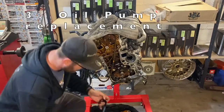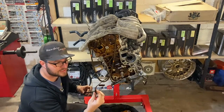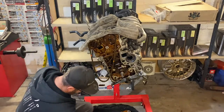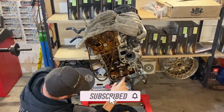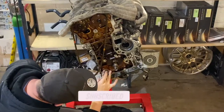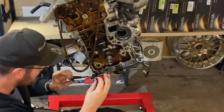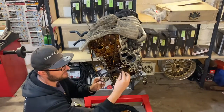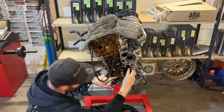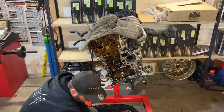After further research I realized it's true, so thank you for that recommendation. It goes without saying that all gaskets must be replaced — this is the old one, this is the new one. It's always important to make sure that the surfaces are really clean where the gaskets sit. There's only one way this gasket can be reinstalled, which is just the thing I was checking to make sure I do nothing wrong. And next is the brand new oil pump.